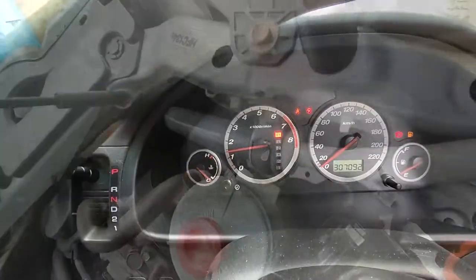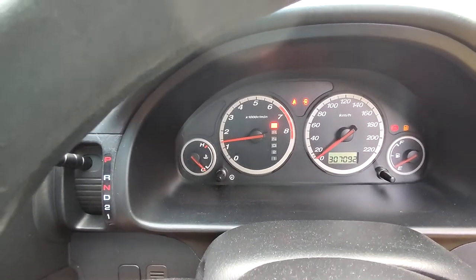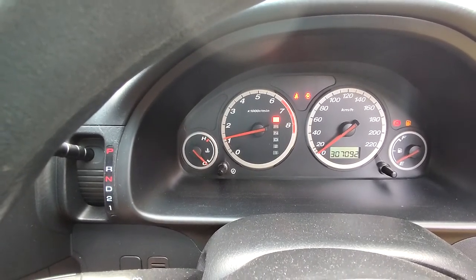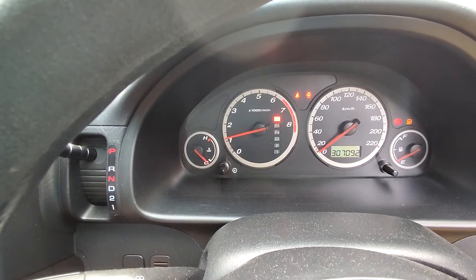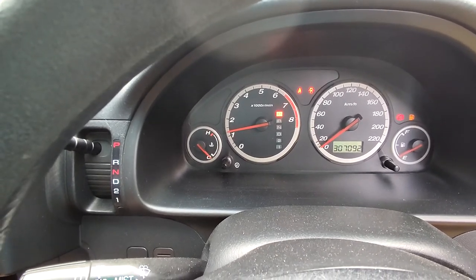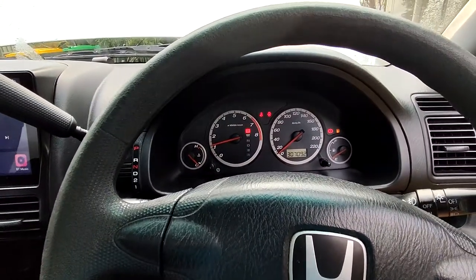Right now I've got the paper clip installed - I did have to do it twice as the first time didn't quite work. But if I turn my AC on now, I can hear the clutch engage and my RPMs drop. Turn it off and on again and I can hear that engage.